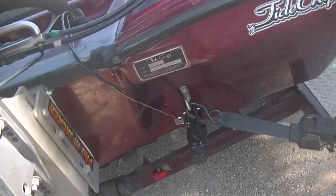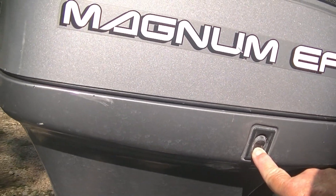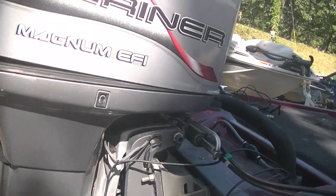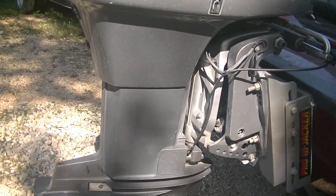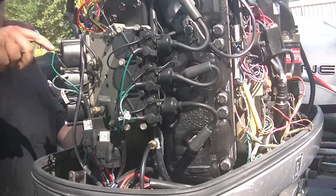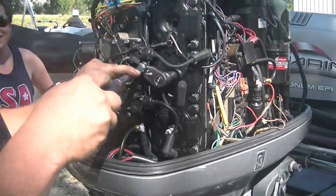Chase here is going to do a compression test on the old Mariner. If you're buying or selling an outboard motor or a boat with a motor on it, it's a good idea. First thing I said was we do a leak-down test - a leak-down test shows you more than what a compression test does. But this is a fresh motor, freshly rebuilt, it hasn't got 12-15 hours on it. A leak-down test is better overall - it forces air in the cylinders and shows you things that compression tests don't show. The motor's also not warmed up to temperature, but I know it's a fresh motor. Otherwise, we want it warmed up.